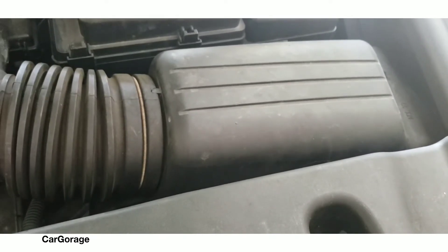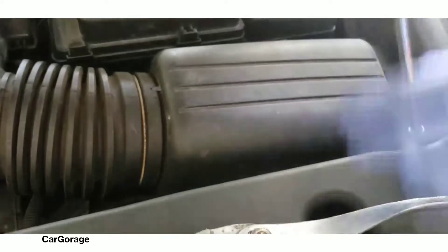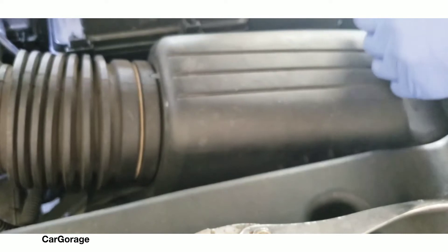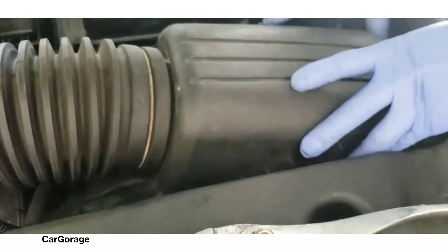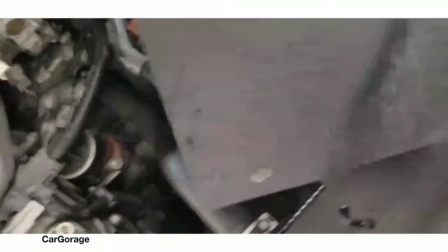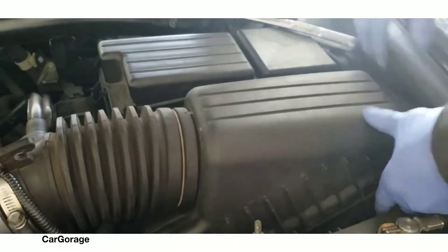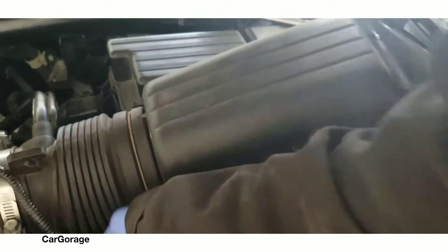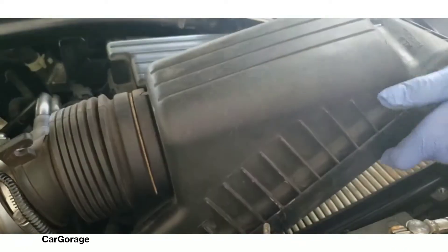If you remove the hose on the valve cover connected to this air duct hose, you won't have to struggle removing the bolts and nuts for the throttle body or removing the throttle body off the airbox. For this airbox, loosen four 8mm bolts and then start popping it off. You'd have to remove that cover in front of it in order to remove it out of there, just like so.